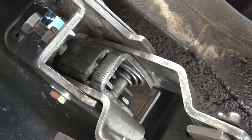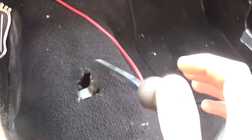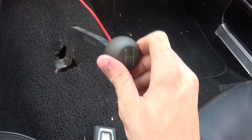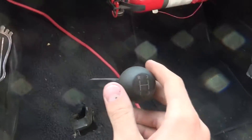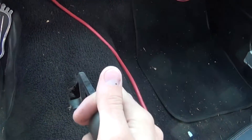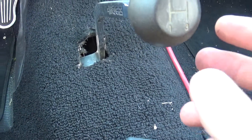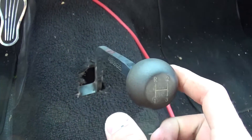So I'm going to get in the car and kind of show you how that works. Here it is on the top — you'll notice it's in neutral. Normal, but when you're in this set of gears — reverse or first — it's not locked in, and that's because that roll pin's out of it, so this is the spring acting on it.